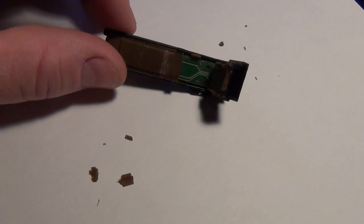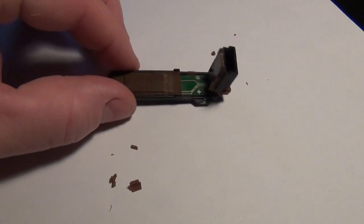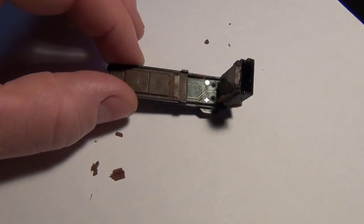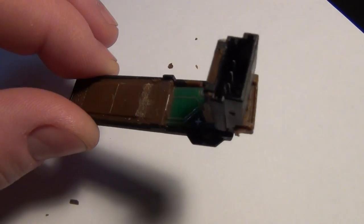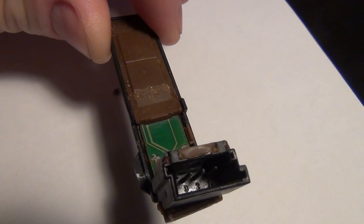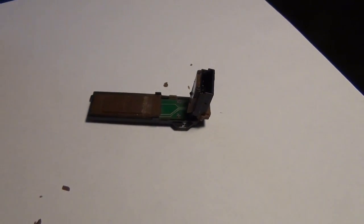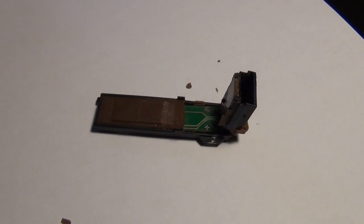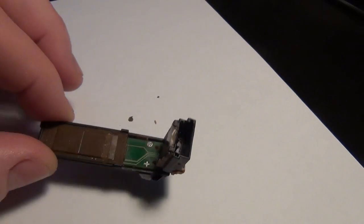Then today I was in the garage, and I figured, let me just take this thing out and take a closer look at it. So sure enough, I took this thing out, brought it up to my bench here, and took a close look at the pins with some magnifying glasses, and I could see that they're all sort of corroded in there. Take my word for it. I'm sure this is the original switch from 2005, but maybe it's not. Either way, it's a 12-year-old car, and this thing's probably pretty old.